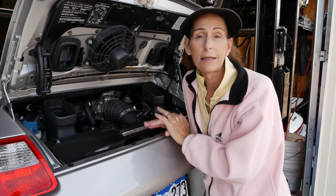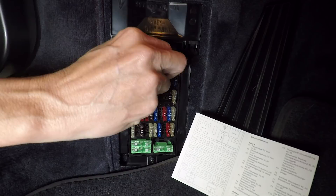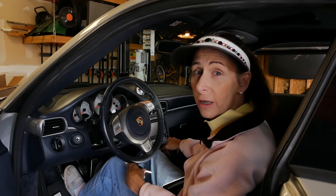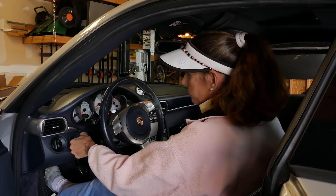The fuel pump fuse is in position ABCD one down here. We pull our fuse puller out, grab that fuse, and pull it out — you can leave it right here for now. With our fuel pump fuse out we go ahead and try to start the car. All right, the car won't start, which is exactly what we were looking for. Now we can get started with our oil change.